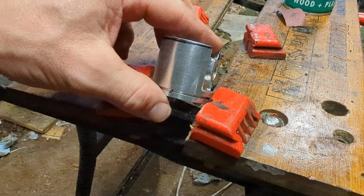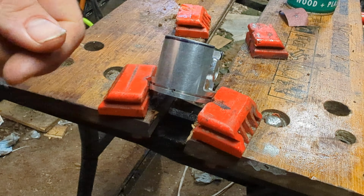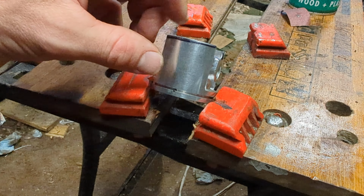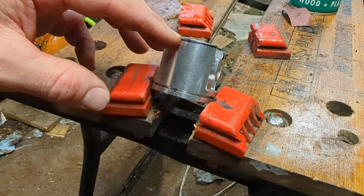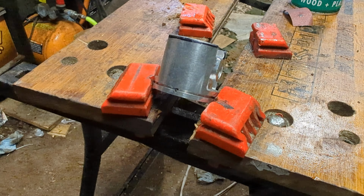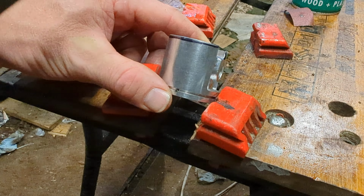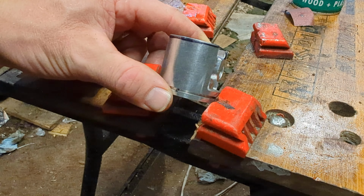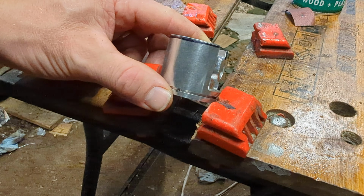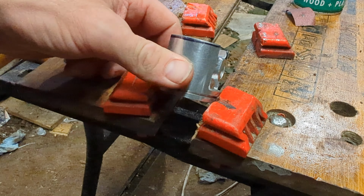That line is at 25 thou. The base gasket, which has been deleted, is 20 thou. I'm going to take another 25 thou off there, so that'll make basically 45 thousandths more intake timing than before. I obviously need a timing wheel to check this stuff. But this is something you can do at home, just with a file, if you haven't got any of the tools, just for a quick performance improvement. Can't go too far with it, but this will give you a few degrees more timing duration.